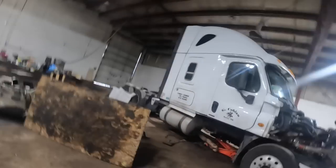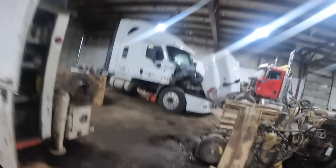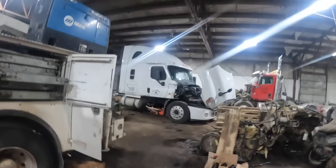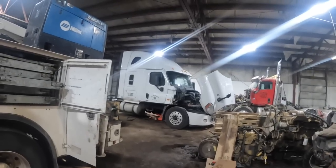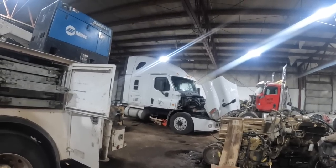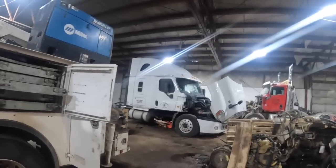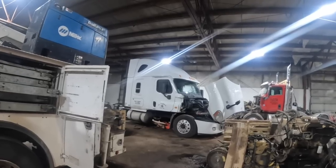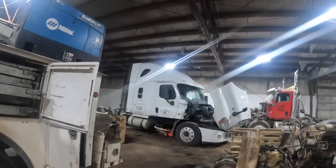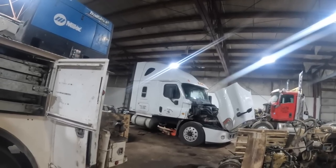Well guys, I'm going to come back tomorrow morning early, and it's getting late. Pull that one drive line behind the transmission out of there. I got it measured. It's about 3.5 inches too short, and then I'm going to pull that yoke off early tomorrow morning. And I'll just have my wife come get it, and I'll throw it in the back of the pickup, and she can take it to the driveline shop when they open. And gonna have to lengthen it out and change that one yoke.